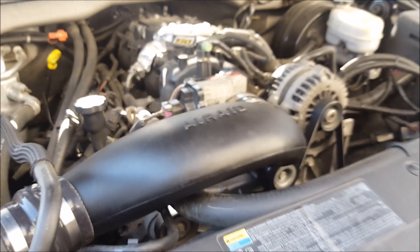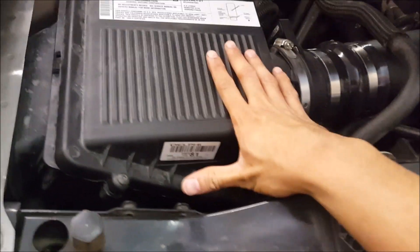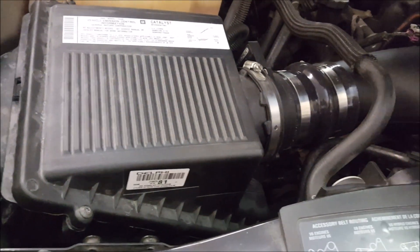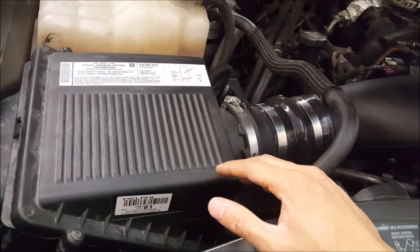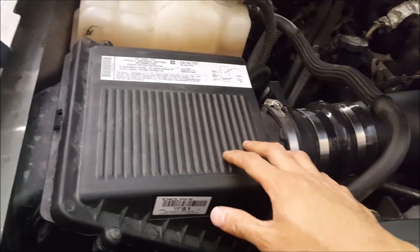We're looking good. Here's our new intake tube — here's the factory air box. We don't have to worry about water splashing in, it's shielded away from the engine compartment, and it's easy to service with just these four torx bolts. You can drop in an Airaid filter, K&N, factory — whatever you want. What I personally do is run a K&N but keep a Fram filter around so when I clean my K&N I drop in the Fram, clean the K&N, oil it, let it sit for a day or two, then swap them back — that way I can keep operating my pickup.